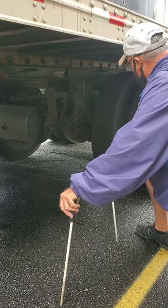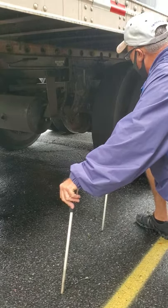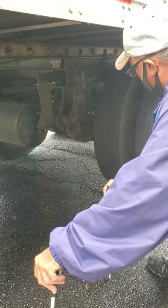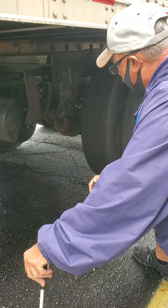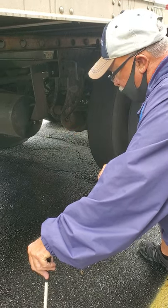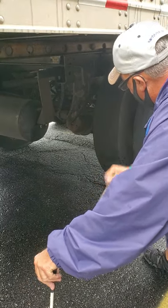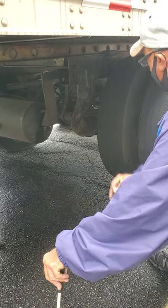This is my third time on the brakes, but I'm going to go ahead and say it. I'm going to check my brake lines, my brake hoses — securely mounted, not broken, missing, or leaking. My brake chambers — securely mounted, not cracked, no damage, not rusted through. I'm going to check my slack adjuster and push rods — make sure all hardware is intact with the cotter pins in place, not broken or missing. I'm going to check my shoes — at least a quarter inch showing, not dangerously worn. I'm going to check my drums on all wheels — make sure they're not cracked, no damage, no oil or grease indicating a problem with my brakes.